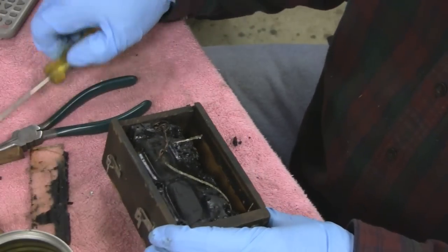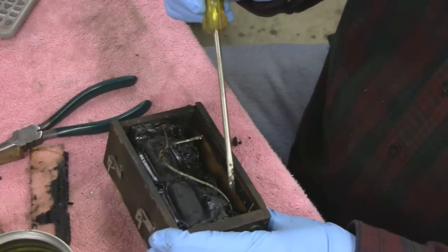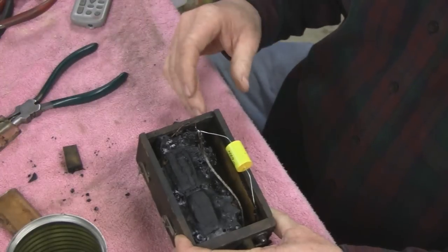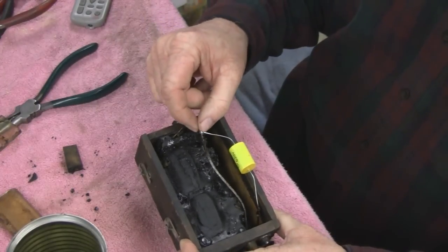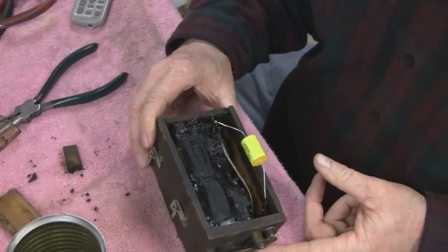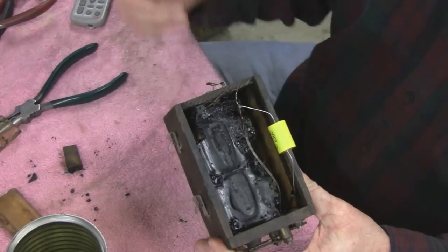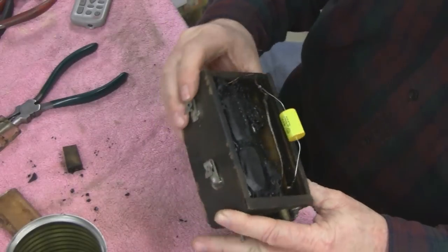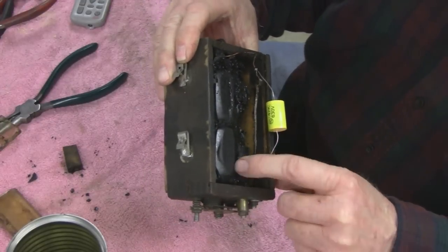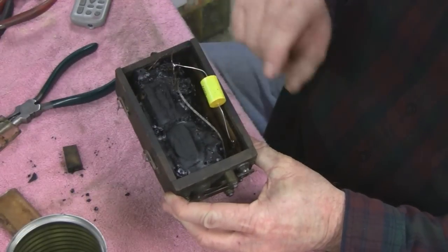Now all you have to do is cut this wire here and this wire here, and put your capacitor right there. I soldered it in — you can see I soldered it to this end here. This connects out to the big terminal, and then this other one goes out to ground. So you have one going to ground here, and then this one actually connects up to these studs — doesn't matter which stud. That stud has a wire going to the primary or the secondary. I just soldered it to the existing wire that was there.